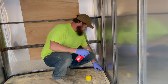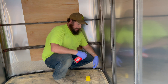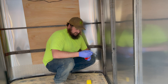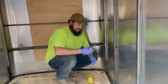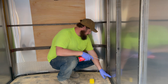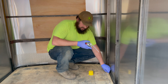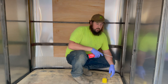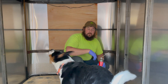Basically what I want to do is — like right here it's got some big cracks in it — so I'm going to fill this in just to kind of help seal some of that moisture, debris, and animals from getting up inside the trailer. This stuff is not much fun to use. Once you get going with it, you kind of have to use it or it's about shot. So we're probably going to go through at least one can. I'm going to do all these edges here where the plywood and the wood meet to kind of help create a moisture barrier, just pretty much anywhere where there could be potential for water or animals to get through — we're going to try to seal up.